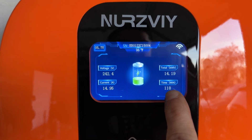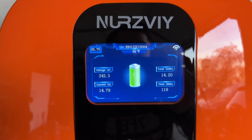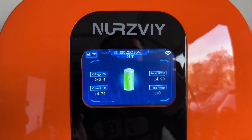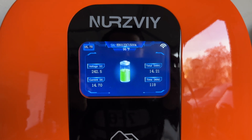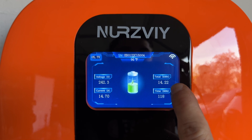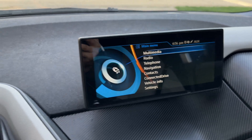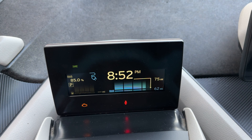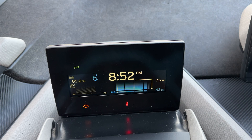It has been about two hours since we plugged the car in. We are still charging at 15 amps, which means the car is basically finishing up the charge — that's how the charging curve on the BMW i3 works. Once it's at a higher level of charge, it slows down how much amperage it can put into the battery. We have put 14.2 kilowatt hours into the battery and our charge is now at 85%.